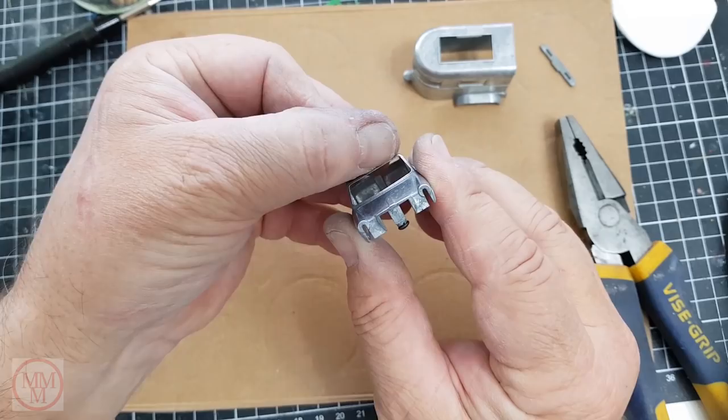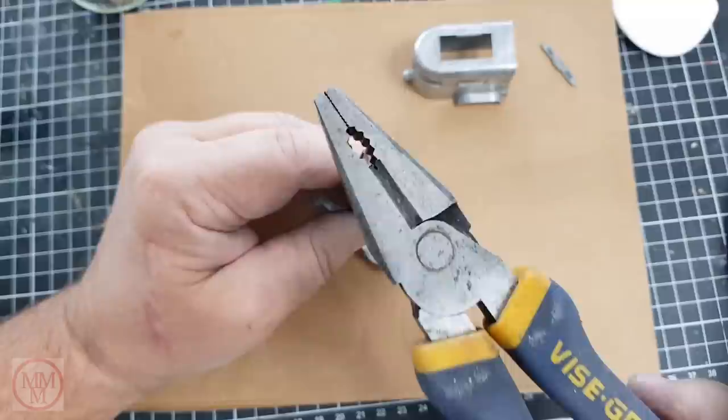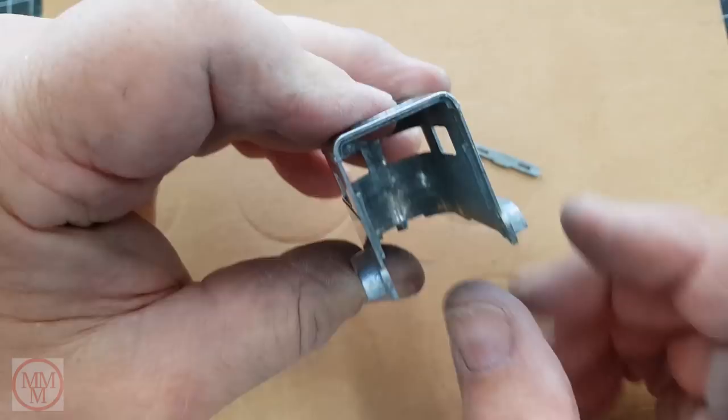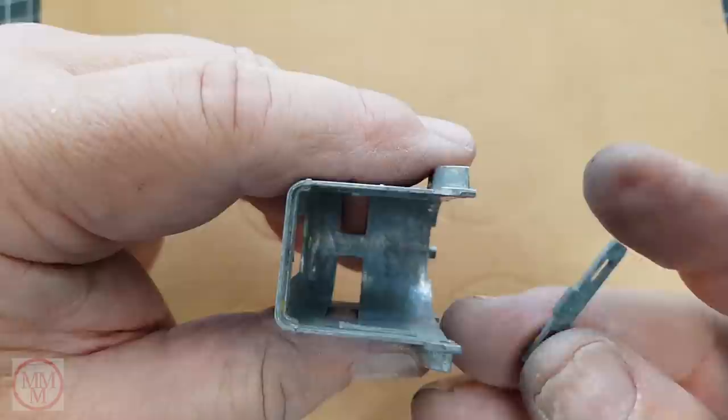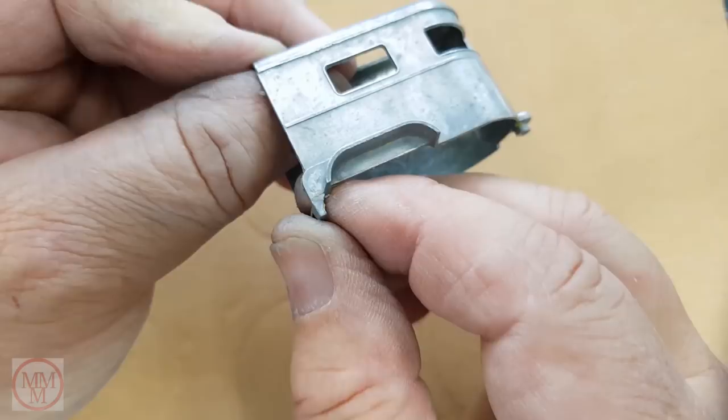This MG 1100 had a slight dent above the windscreen. I removed it using the rounded end of my centre punch and just tapped it out using the pliers as a hammer — I'm happy with that. However, I was a little overzealous whilst removing the paint from the trailer and actually snapped the rear brace off. I'm a little bit annoyed with myself and I'm going to have to repair it now, so I've made myself some extra work.